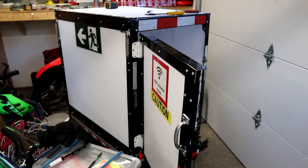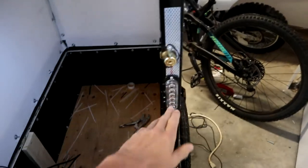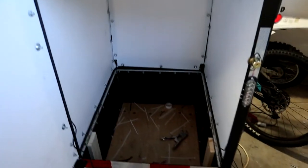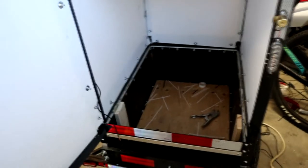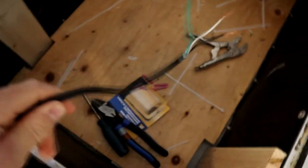I've kind of changed from my original plans. I'm going to have these two lights and the light bar — all the ones facing the back — on their own circuit, so I can turn them on separately from the rest, in case I only need the rear lights on. I almost have all the others spliced together. This cord right here will connect to the battery and supply the whole circuit of all the lights except the back ones.